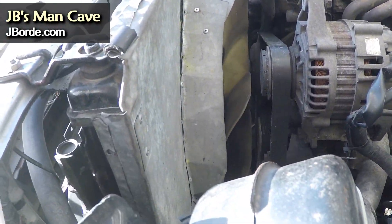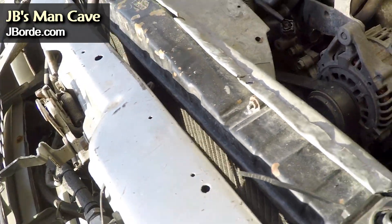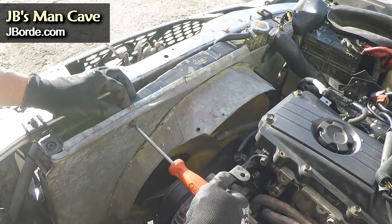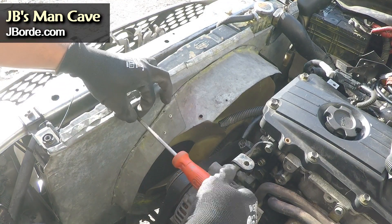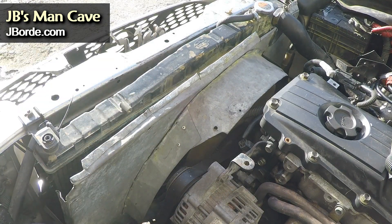Having a shroud makes sure air is pushed through the radiator to cool it. Here's how it looks from underneath. I use rubber on it to prevent the sheet metal from touching the radiator. I'm showing you where I bolted it on — you'd have to come up with your own design because more than likely you won't have the exact same radiator. But I'm just showing you what I did: put a hole in your sheet metal, put on a screw or bolt, whatever works.